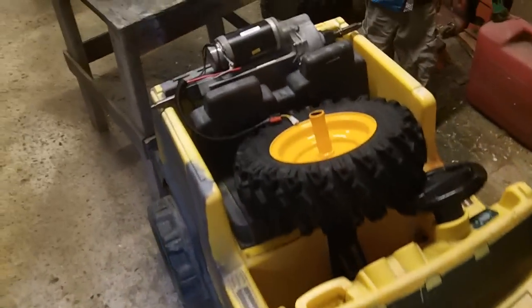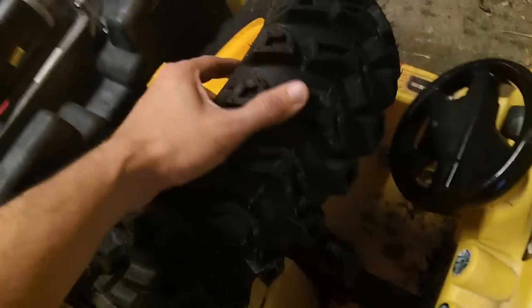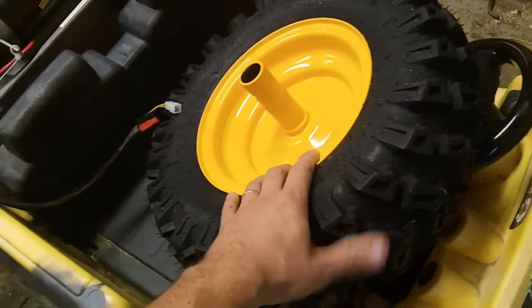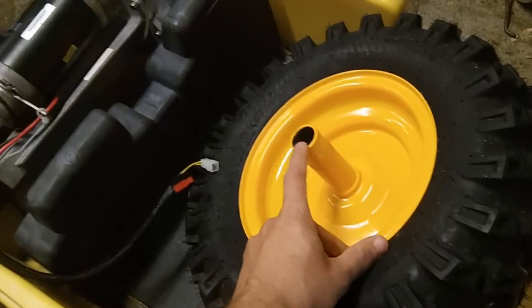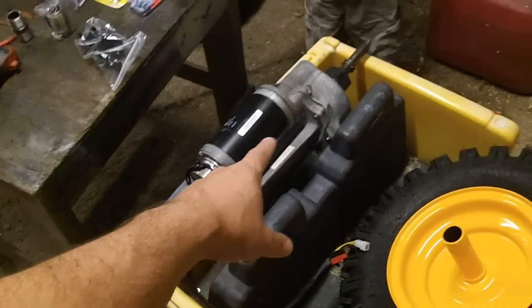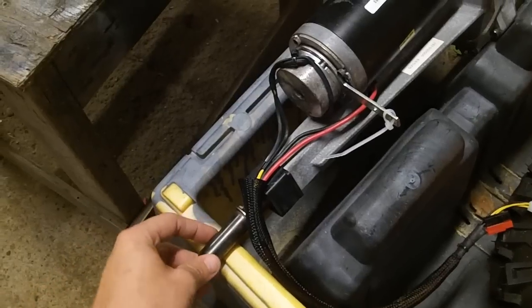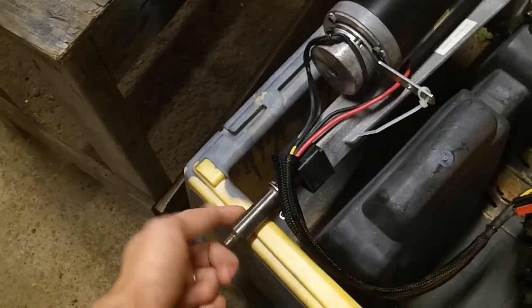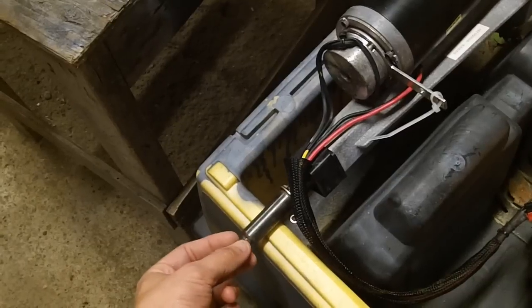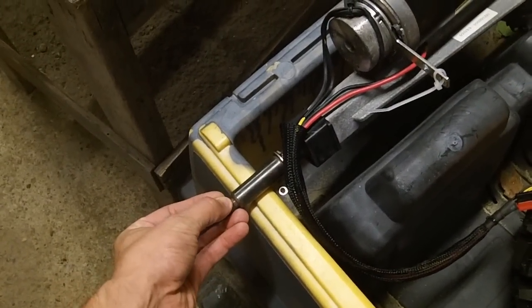What we've decided to do is take this to a whole new level. We've got these X-Track tires on 8-inch rims — they're actual pneumatic tires with a 1-inch area here. And we have this mobility scooter rear end. The problem is it has a 3/4-inch shaft, but the nice thing is it's got a keyway on one side and a mounting thread on the end. If you get these from Surpluscenter.com, both of these are from there, and they actually include the nylon lock nut.